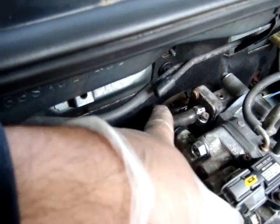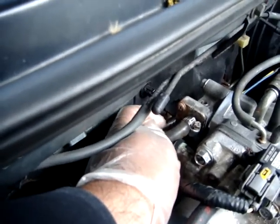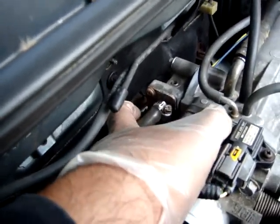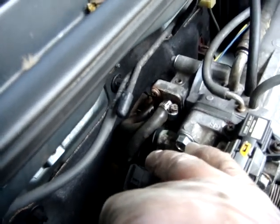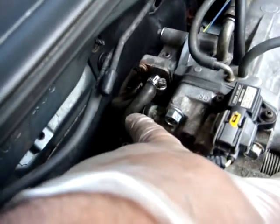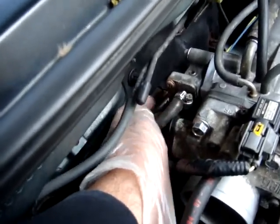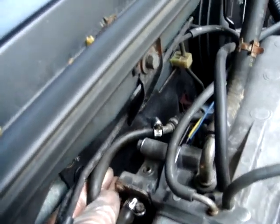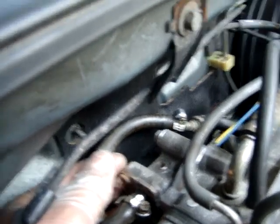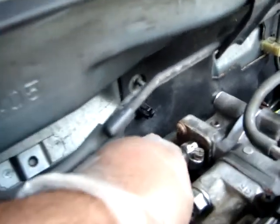What you'll most likely have to do is cut the coolant port on the bottom that goes from the coolant pipe up to the IACV — this will hit it. I'm still having a little problem installing this because it's a little tight. You will have to cut it down short because this piece is a little long, and I did have to extend the coolant hose. I used a nipple from a thermostat housing and extended it — you can see it there.